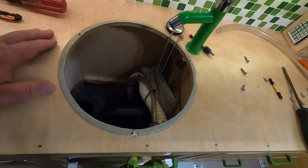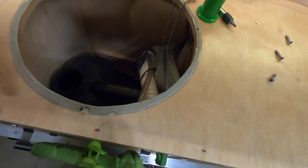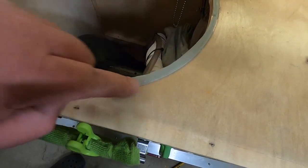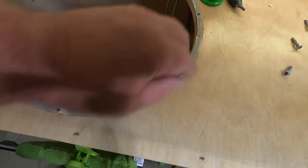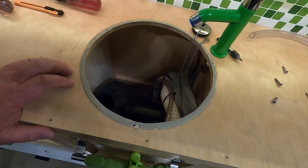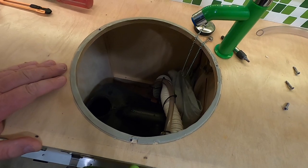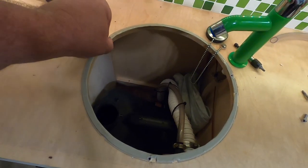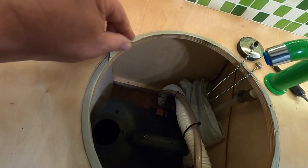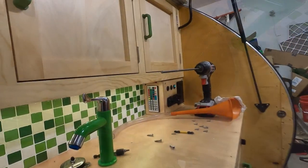I've used butyl tape all over this camper and it's done a very nice job. I used a very thin strip and scored it back so it's barely touching the bowl — I really didn't think water was going to get under there anyway, but I made it a very close tolerance. I've tried butyl tape from a couple of different places — I tried some from Camping World and some from Vintage Technologies. The stuff from Vintage Technologies is really good, very drippy and goopy. Look at this — that's three years later. I'm not sponsored by them, I just believe in the product.